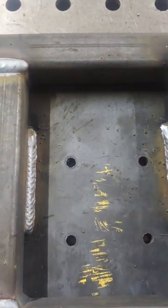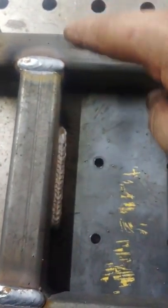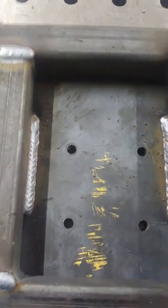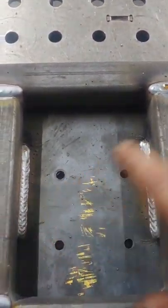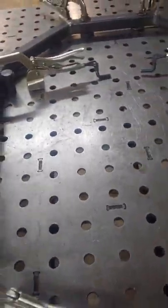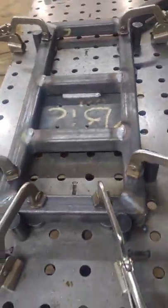Right here it's a three inch weld on both of these in the middle. When I flip it over there's going to be a three inch weld across the top on both sides, so it's 100% welded — it's not going to move. We do this like a stitch so the frame doesn't warp with too much heat and it can't hinge. This thing is extremely stout. I've never had a frame fail yet, and we've had them on really heavy bikes with no problem.